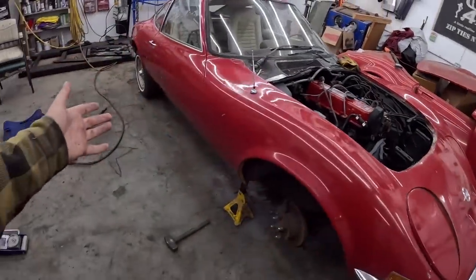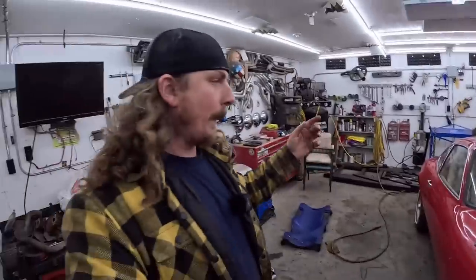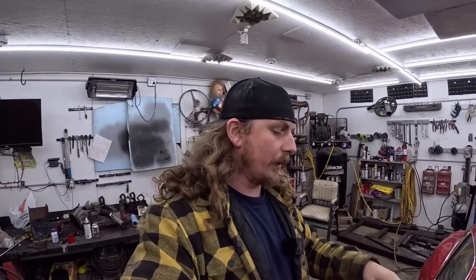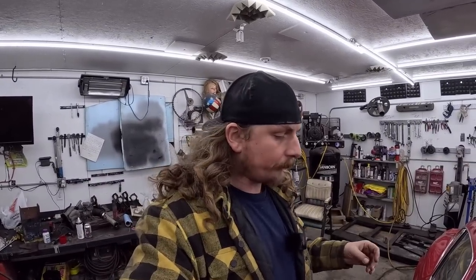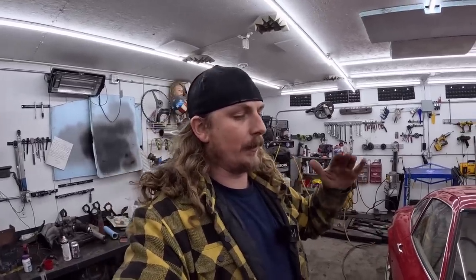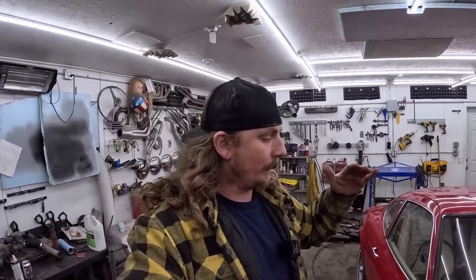We have the engine crane out of the way. I just welded a pipe across the transmission. Now, this car actually has a two-piece drive shaft, which I don't think I have the second piece anyways, but it'd be very short. This transmission is now longer. So I gotta decide. All I did was weld a pipe there to hold it, because I don't know what I'm gonna do for the angle for the transmission mount exactly. We're in the ballpark. I mean, we're not crazy out to lunch.